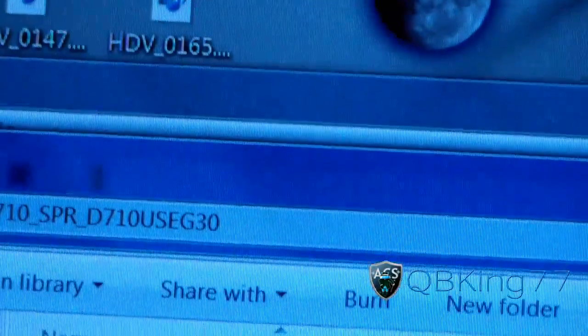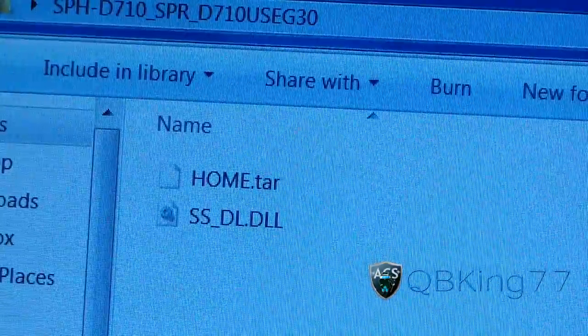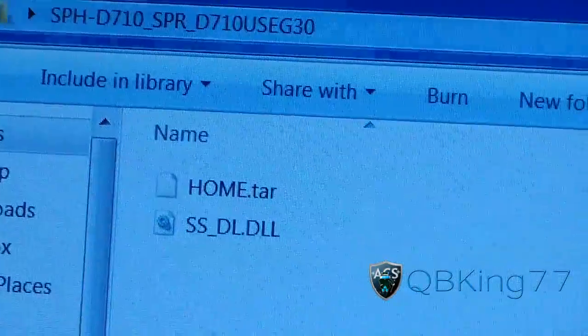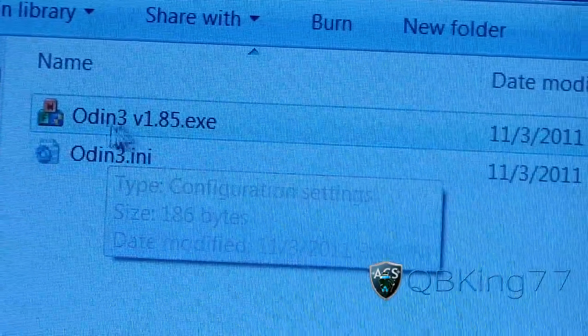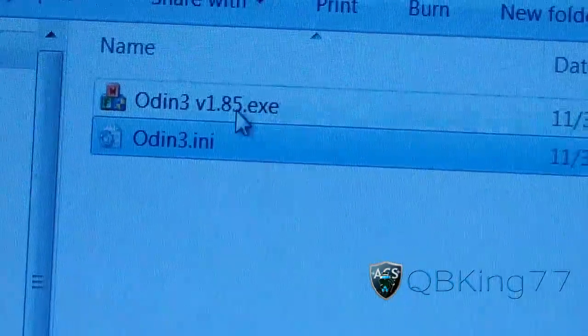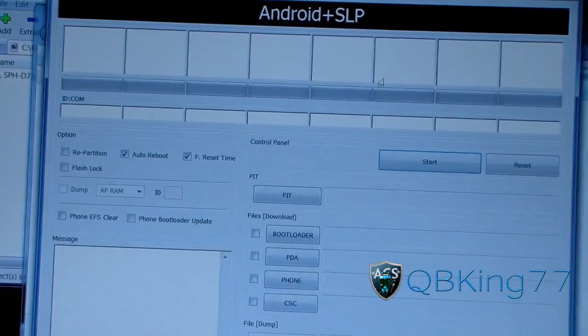The folder will look like this on your desktop. Double-click on it and inside you're gonna see something called home.tar. That home.tar is actually the EG30 tar that you need. Once you have that downloaded and extracted out of the RAR file, you're ready to go. Open up Odin wherever you put it. Double-click Odin, hit Yes, and it opens up. This is Odin right here.